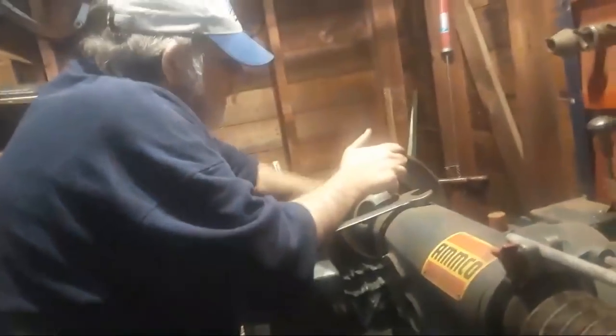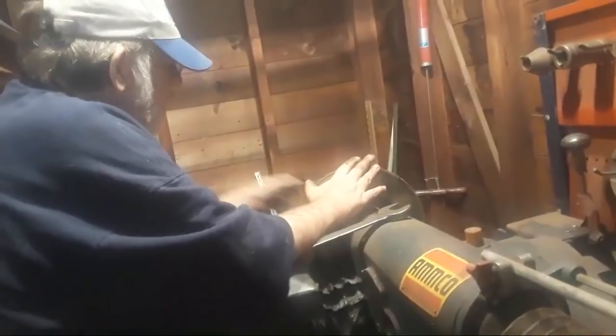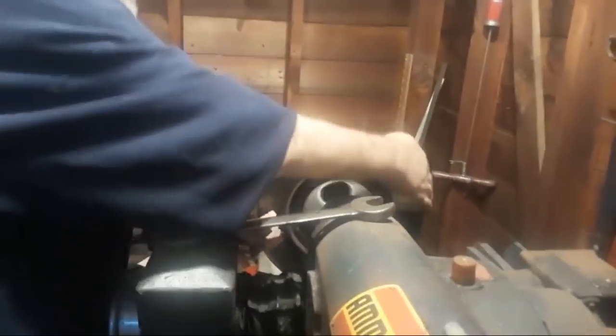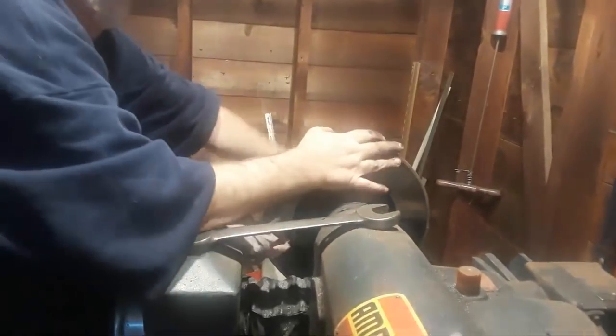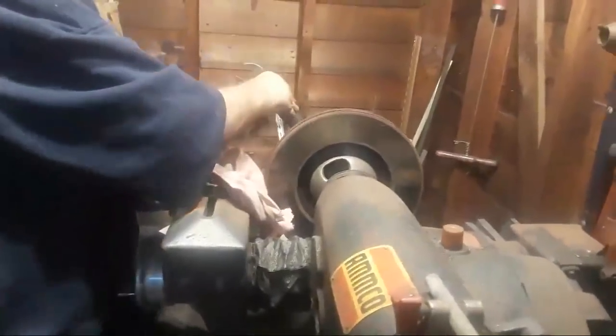Hand me that disc right there. Yeah. Okay. Disc cone. It goes by both names. What we're going to do is get this on here, and then I'm going to put on my vibration ring and start my nut. Now, the nut is left-handed because this spins right-handed, so the nut won't loosen up if it's a left-handed nut. We want to spin it a little bit just to get any rust and scale out of there, and then tighten this back up with my wrench. We do want to make sure that this is snug.